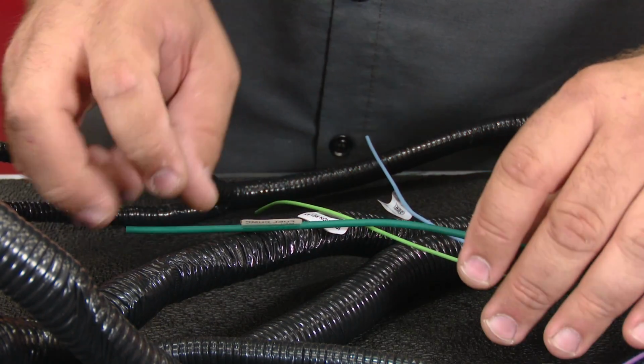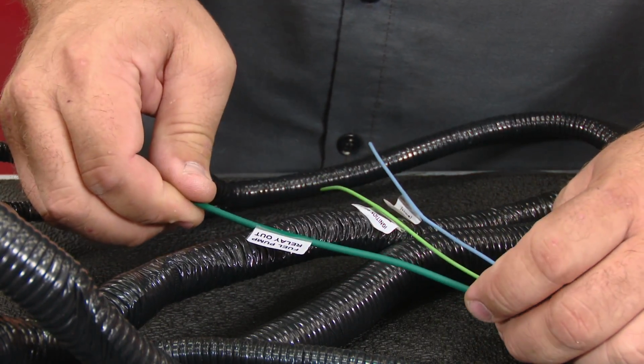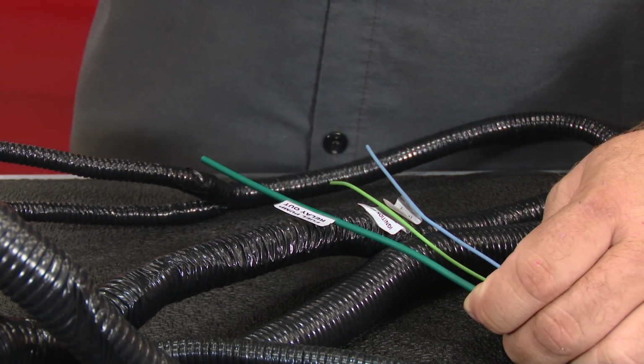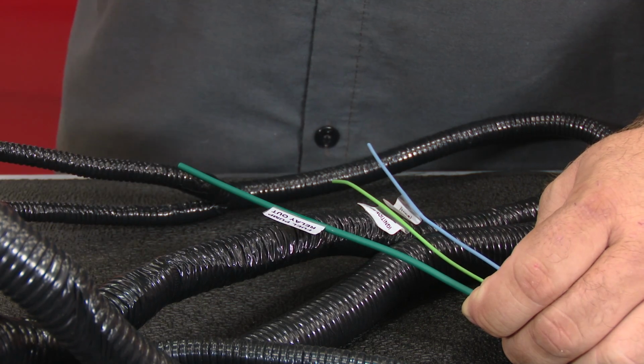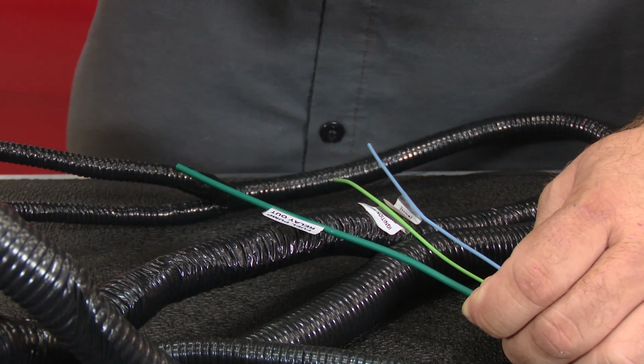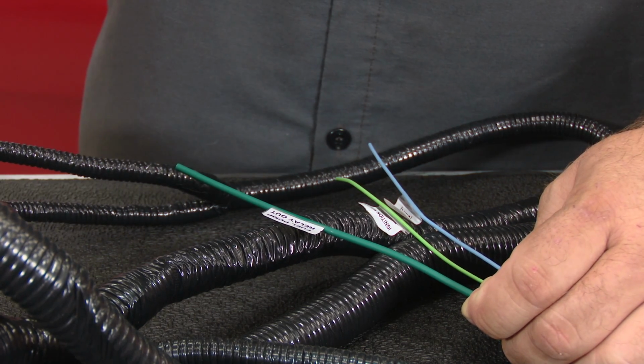All right, now the last three, these are the ones you need basically to get the car running. These are going to be the important wires. Fuel pump relay out, this is going to connect to a positive lead on your fuel pump. What this is going to do is this will turn your pump on when the computer receives power.